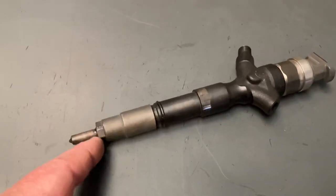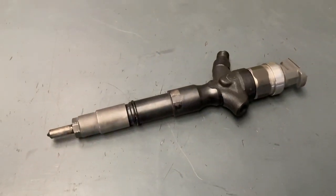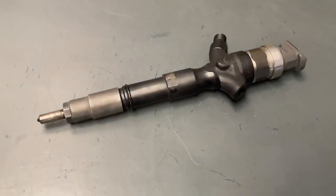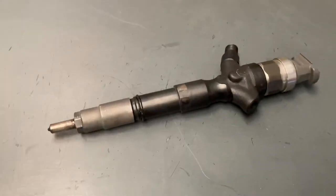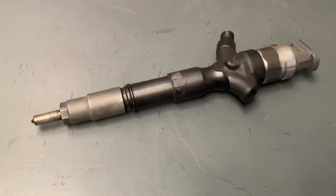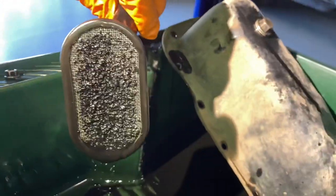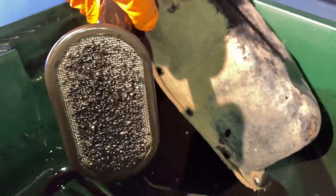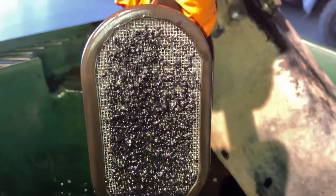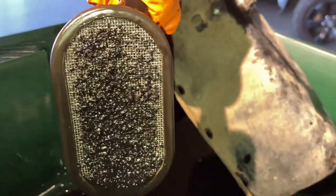After you do all this you might need to change your oil again, because cleaning the oil pickup can send debris back into the oil system and block it up again. You need to be very careful of that situation. Before we spray it, let's have a look — it gives you a much better picture. Watch out for drips from above. If the screen goes black like a blood splatter, it's just oil dripping off the engine above us.